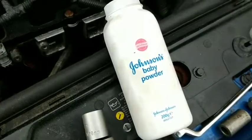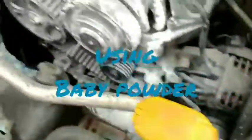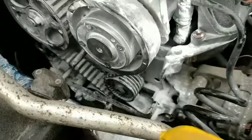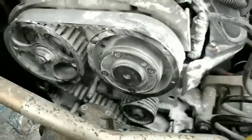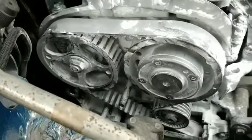When you can't find your oil leak because there's oil all over the engine, you can spray it down with baby powder so it's totally covered, then start the car. Not too much that it's going to ruin the belt by making it come off, but enough that you can see it dusted over things. I'm going to start the car and see where the wetness of the oil is originating from first.